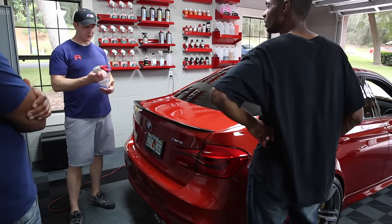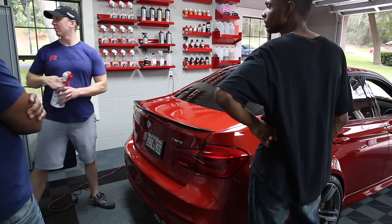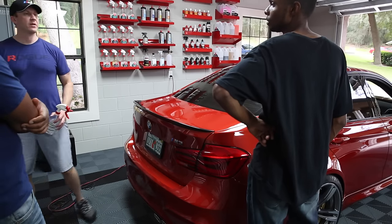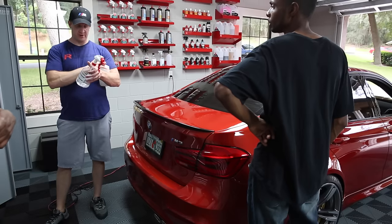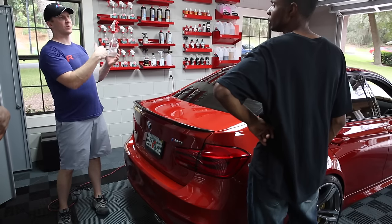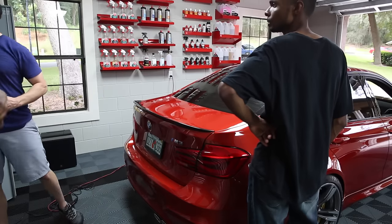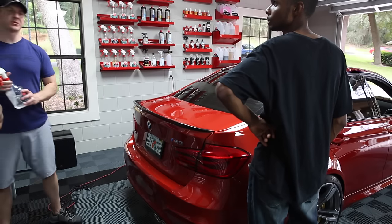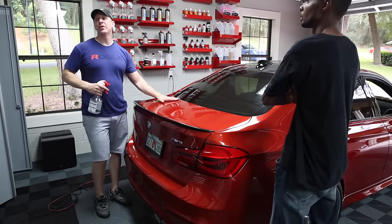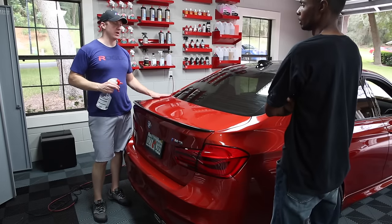Okay, so this is 20%. Your normal rubbing alcohol, IPA. If you have a Walgreens, buy some IPA and put 20% and then the rest water. You can use distilled water or regular water. If you use the 91%, I've used it straight on the paint before, but it could soften the clear coat, and the wrong clear coat could really mess it up. So you just want to be careful.